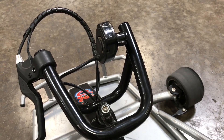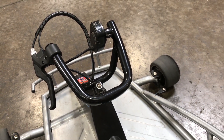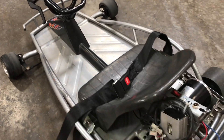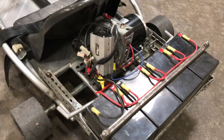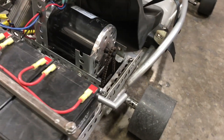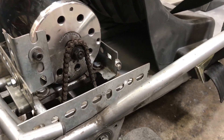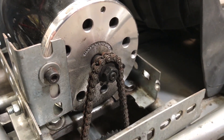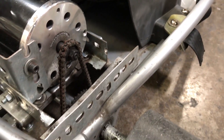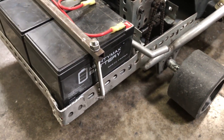I'm going to list the parts we used in the description below: the motor, the controller, the batteries, and the sprocket on the motor. You need to replace the sprocket that comes on the motor because it's for a different chain size — I'll put that information in there for you. Other than that, you've got to run down to Home Depot or your local hardware store, buy some angle iron and metal reinforcements, and have some fun on a Saturday afternoon rebuilding the back end.